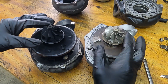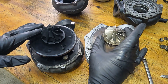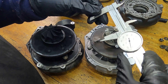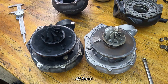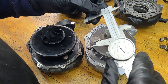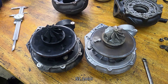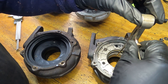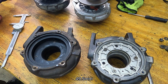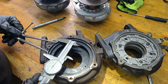Comparing side by side again, it's not just that this is a newer turbine wheel — the dimensions are a little bit different. The hybrid turbine wheel tip diameter measured approximately 1.925 inches, and at the base the geometry is a little different, coming in at about 2.015 inches. Additional measurements on the hybrid side showed 1.950 inches and approximately 1.870 inches in other positions.